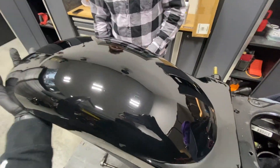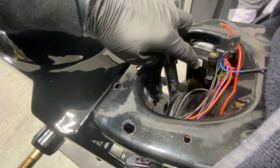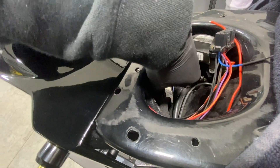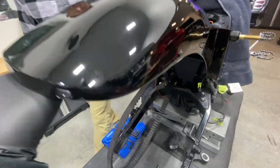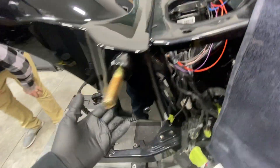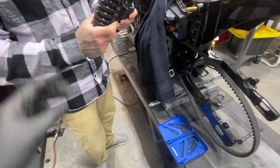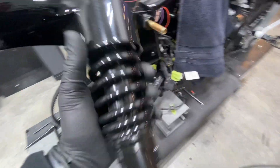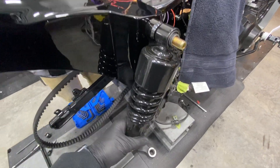There was some slack in the rear fender before, so what we did was find these two old bolts and tapped the actual frame so we can tighten them down and shim it — this thing is rock solid now. It's as high as it's going to sit, so now all we have to do is tighten that base plate down and then install the shocks. As you've seen in one of our last videos when we were mocking it up, we're using the 10-inch Burly Slammers.